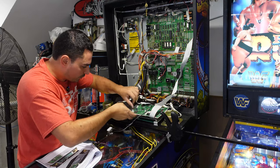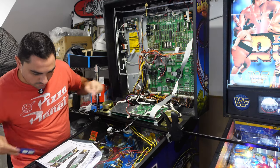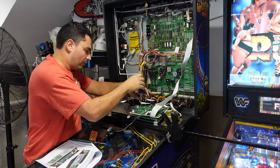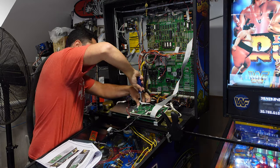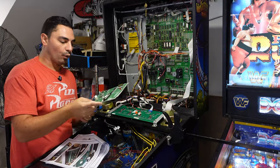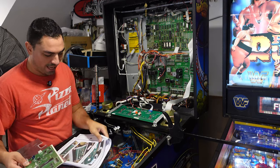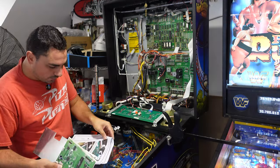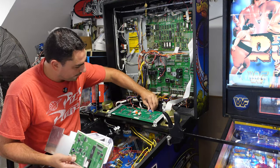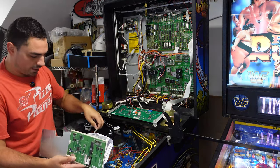Looks like I need one more screw to remove, and that is this one here. It's not in the picture, but that should be a-okay. Again, we are right now removing 5 screws to take out this metal plate. All right, got the metal plate off with this board. I had one pesky screw, but needle-nose pliers solved that. Next, we have to remove this 14-pin ribbon cable, but we have to keep it aside. So we got this little ribbon. We're going to keep that aside.